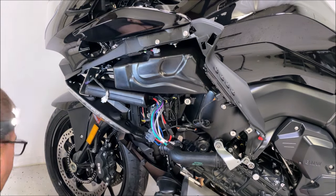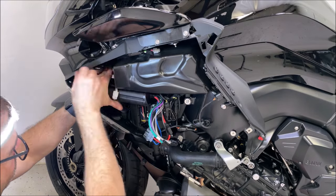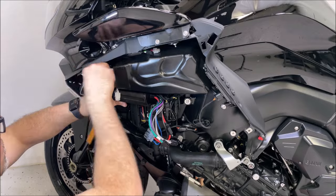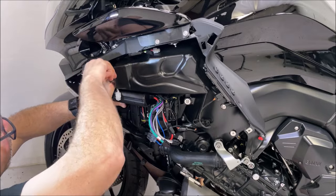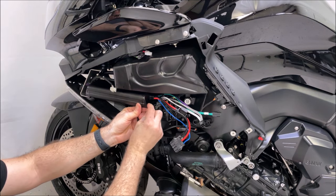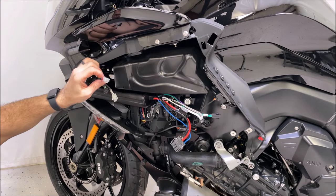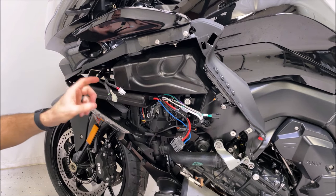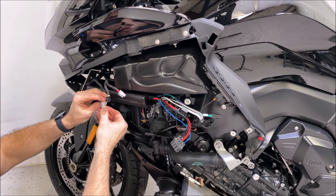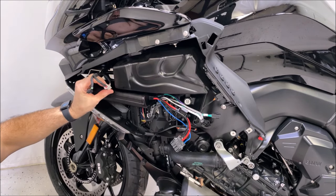The amp is seated in there. Now wire tie right here to the other foot to hold that end from wiggling. This is the input plug to the amplifier — it has a matching white plug from our harness that ran up to the top. Put a little dielectric grease as an extra precaution into each of those plug holes, then plug the harness in and it's ready to go.